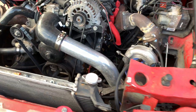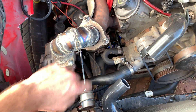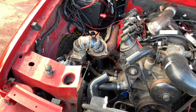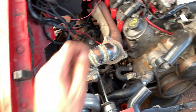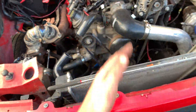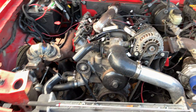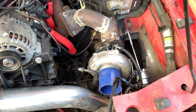As you can see, the turbos are off to the side now. Don't mind the welding — that's my first time pie cutting something and it seemed to work rather well. I set it to 15 degrees, cut it both ways, and ended up with a nice little pie cut. This one I just cut, flipped it, re-welded it, and the turbos are off to the side.